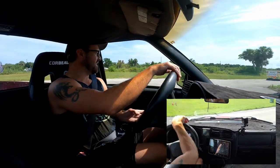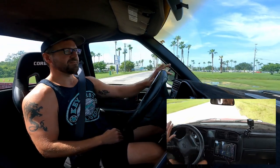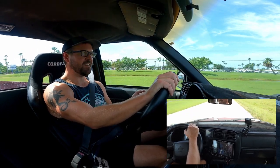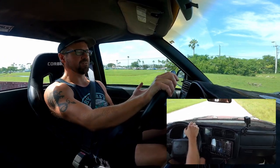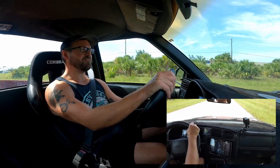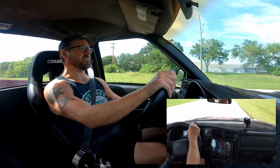After the initial testing last night in the garage, hearing how long the pump stayed on for, I was a little nervous. But I think it just takes that long to hit full vacuum, and even at half vacuum, when the pump actually kicks on, you still have more than enough. It's still got more vacuum, technically, than this thing had at idle, running off the engine vacuum, so it might just be fine. While you're driving along, you definitely can hear it. So that's nice.